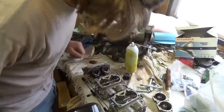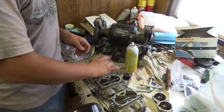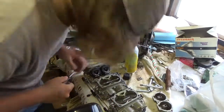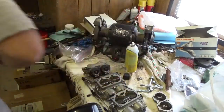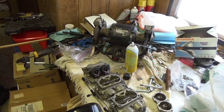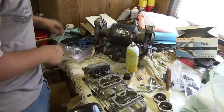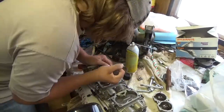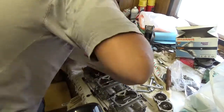You can see in there. The needles — I call them jets, I don't know the technical terms — but the two center tubes between the floats, those were all gelled up as well. I also found some stuff in the bottom of the float bowl and in some other venturis, so I cleaned all that out. I had to get a bigger screwdriver because the one I had was too small and I still couldn't get the things to come out.